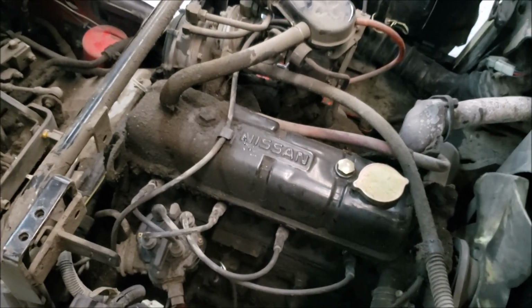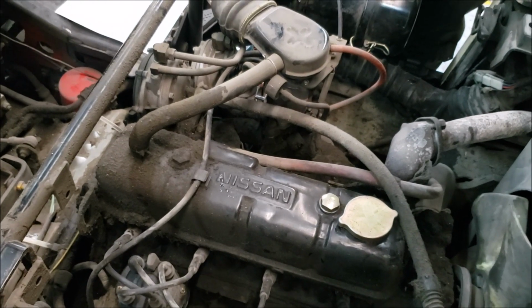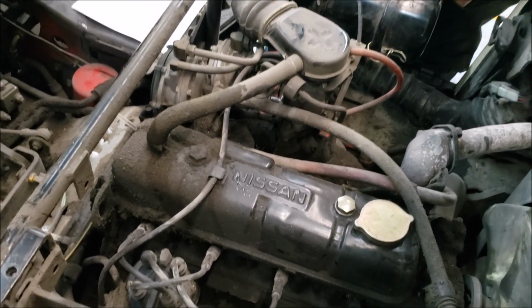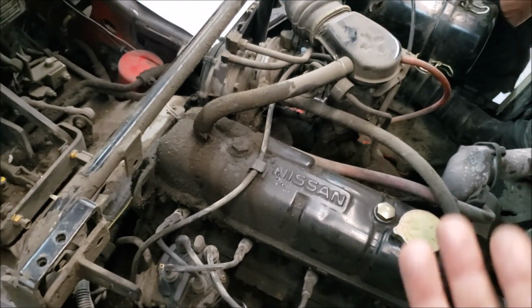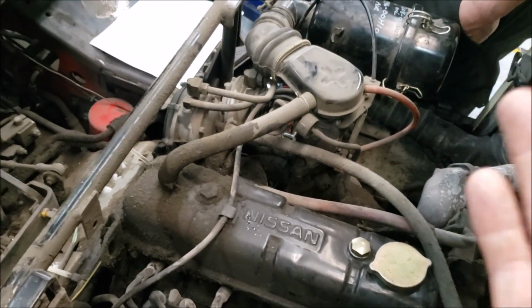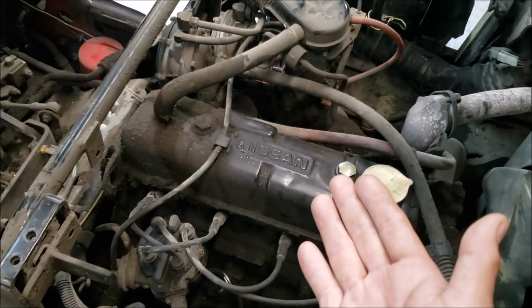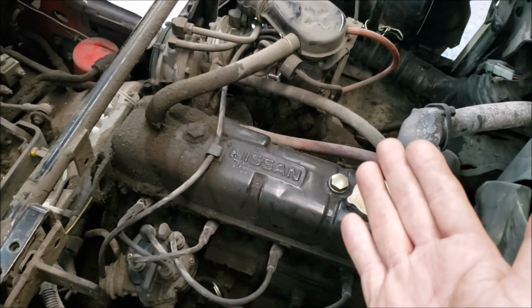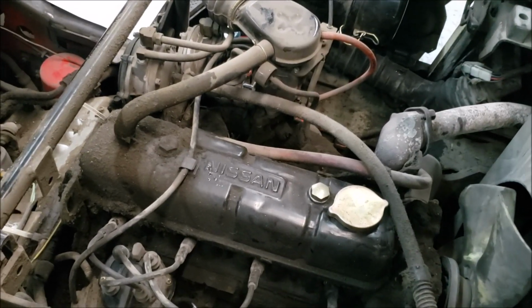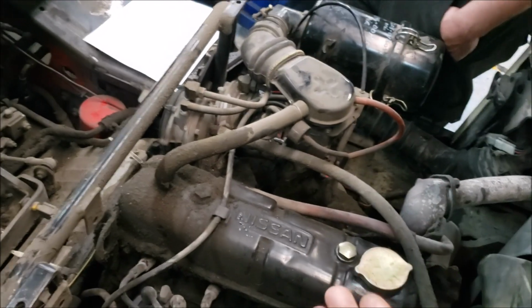Why? Because if I have a high electrical resistance, would it have a high current or a low current reading on the amp clamp? Low current. That's why I said electrical resistance, not mechanical resistance. Electrical resistance in the cable would produce a low current reading, right? The current needed by that starter to start spinning would be at least 600 amps to start, and then would drop down to like 200, 150, depending, right?